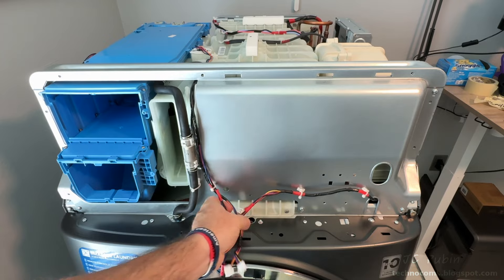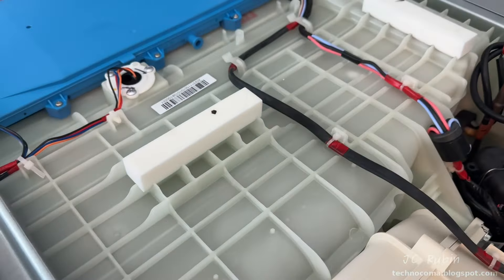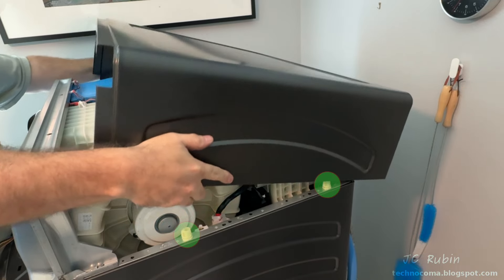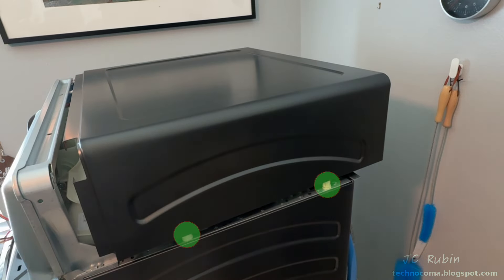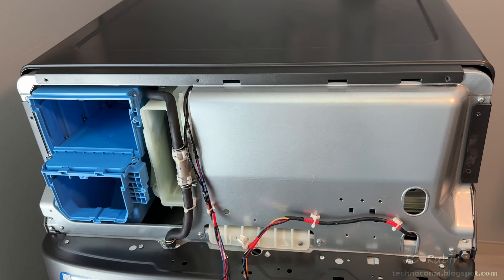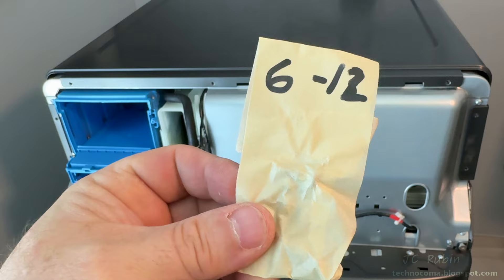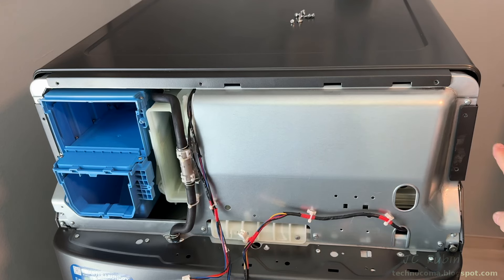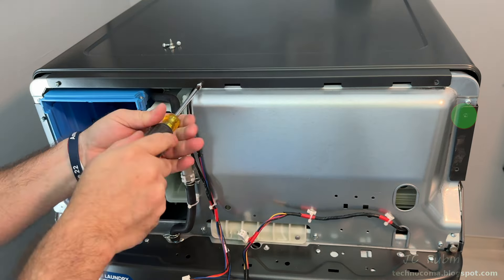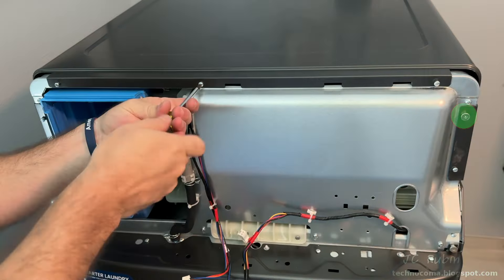This entire reassembly looks factory. We'll now install the top cover — guide pins on each side of the unit line up the cover, bringing it forward into position to lock it in place, making sure the front overlaps the front face of the unit. It is then secured with seven screws labeled six through 12. The one special screw is installed first, then everything installed about three quarters of the way to line up, and then all are snugged down.